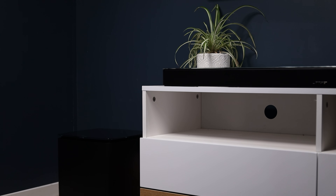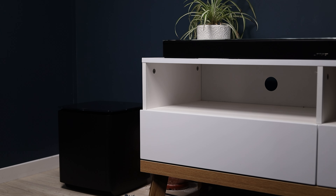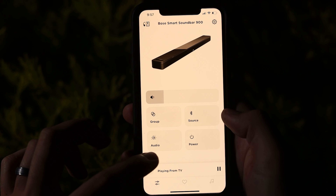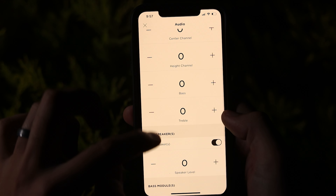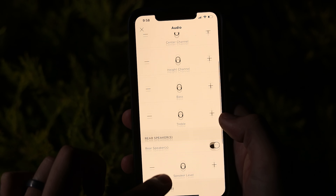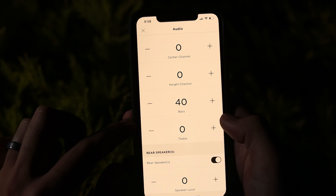Other genres, such as drama, talkback, or acoustic music, don't often require the low-end, so you'd be fine with just the soundbar. The great thing about the system is that you can start with the soundbar and then add the sub later if you find it lacking in low-end performance. Here's a tip: within the app, the sub level changes how loud the sub is, but if you want more deep, punchy bass, adjust the soundbar bass figure. I found it ideal at 50% sub and 40% bass level in my room, but you can use that as a starting point.